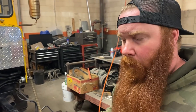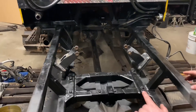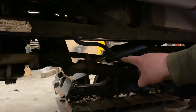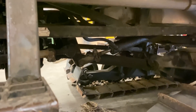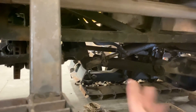We had people asking some really cool questions in the last video, and one of those questions was: how does the snowcat steer? How does it work? So I'm going to talk about that real quick. If you look inside, you can see this long rod. That right there is our hydraulic ram — that's our articulation assembly, and that is our front steering rod. All this thing uses to steer is one hydraulic ram that either pushes to turn right or sucks in to turn left, and the whole thing operates on a pivot.